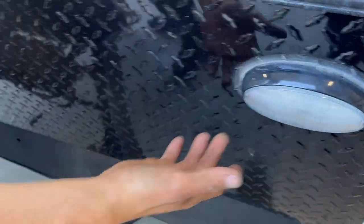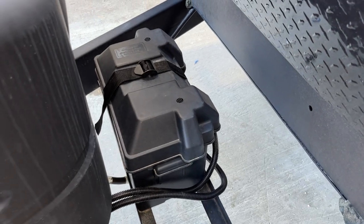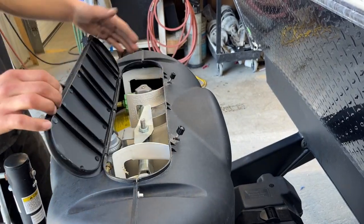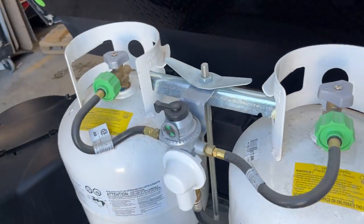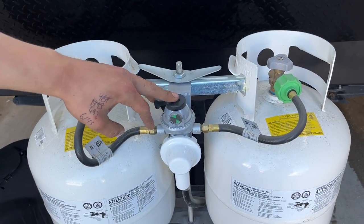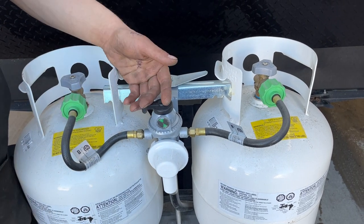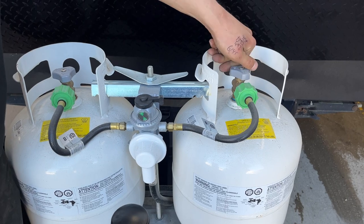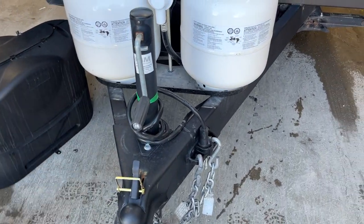Turn around to the front of the unit. There's a little service light on the side with a switch on the bottom. This black box has your battery inside — as long as you're plugged in via that short cord in the back or your seven-pin to the tow vehicle, that battery is charging for you. These knobs, if you loosen off and push back, give you access to your propane tanks. You can see we're currently green, pointing to this tank, letting us know we've got propane and we're running off it. If it goes red, it's letting you know you have no more propane — at that point slip over to the other tank and run off that one while you get the first one filled. Up at the front of the unit is a standard tongue jack — one way's up, the other way's down.